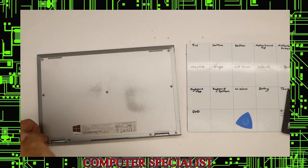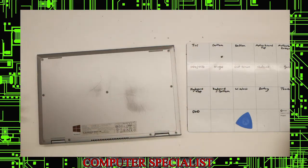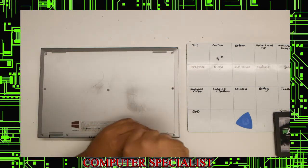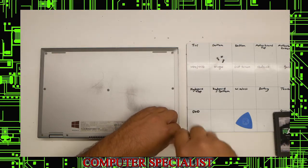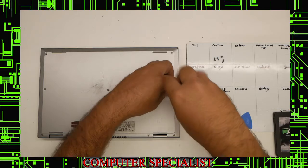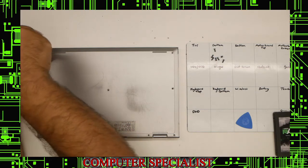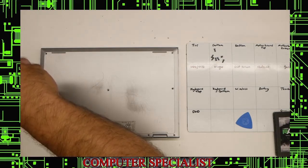You're basically going to take out nine screws. If you don't have a magnet pad, I recommend you go get one — very useful. You can label it however you like. We have a set standard thing that we use and we change it as we change the design of these laptops. We're basically going to pull all these screws out. They're all the same size. Sometimes the hinge screw would be long, so we isolate them knowingly and place them according to where they are. This one's pretty simple — these are all the same.